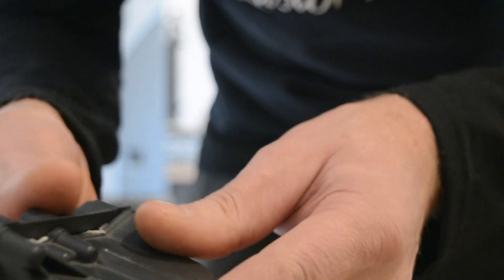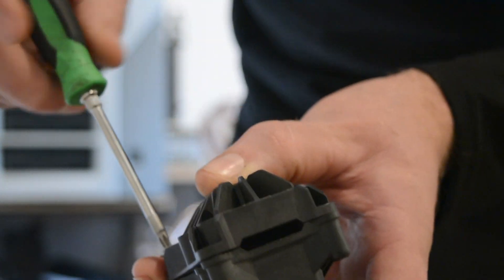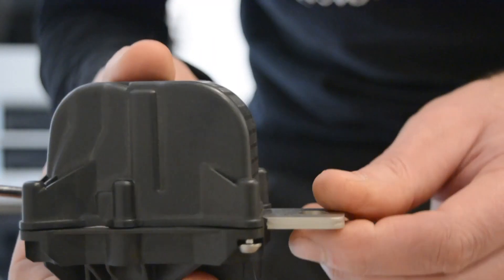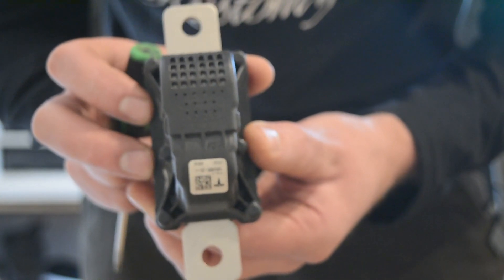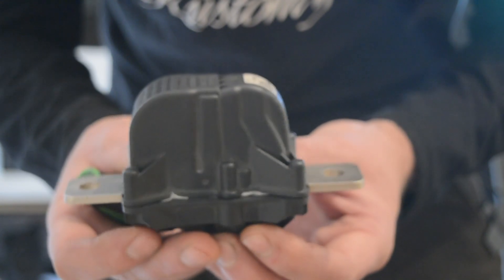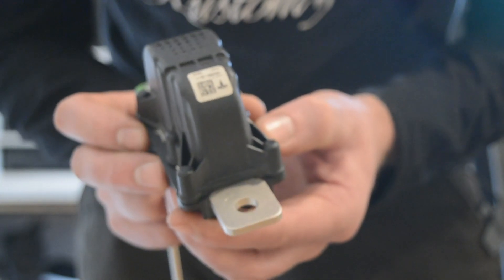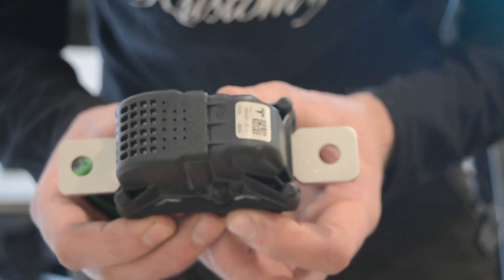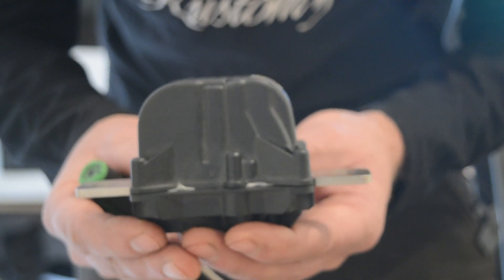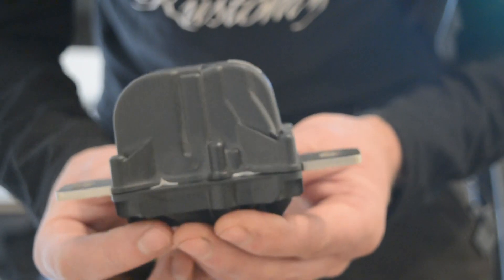So if in an accident somehow one of the contactors had seized on or welded on, when this blows it physically splits the pack in half — so it's safe for any first responders. Very clever little device. I did note that in the top of the penthouse there is an access port to this. In the event it needed to be changed, instead of removing the entire cover, you just pop off the access port. What I would have liked to have seen is some sort of plastic flange around that just to isolate the top. You are to be using voltage-safe composite tools for all of this, but in the event of some sort of isolation error or pack damage and somebody gets in here with a regular chrome extension and contacts the side of it — just a little suggestion. Accidents do happen.